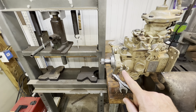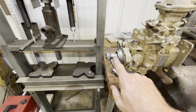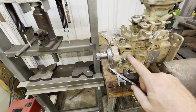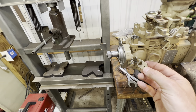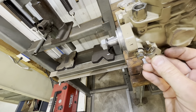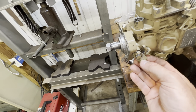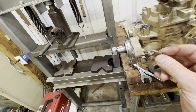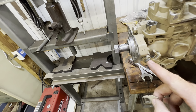That is all you have to do to time this pump. It's ready to go in now. Pay attention: you have to back this nut off, make sure the keyway stays in place when pushed onto the gear — and that's it, it's that simple. One more thing: once you actually get the pump in your vehicle, it's mounted in the cover, your fuel pump gear is on and torqued down to the proper spec — very important — then you can finally back this locking bolt off. If you don't back this bolt off and you try to start your truck, this shaft is going to turn with the bolt against it and you're going to have metal pieces going all over the place inside your pump.